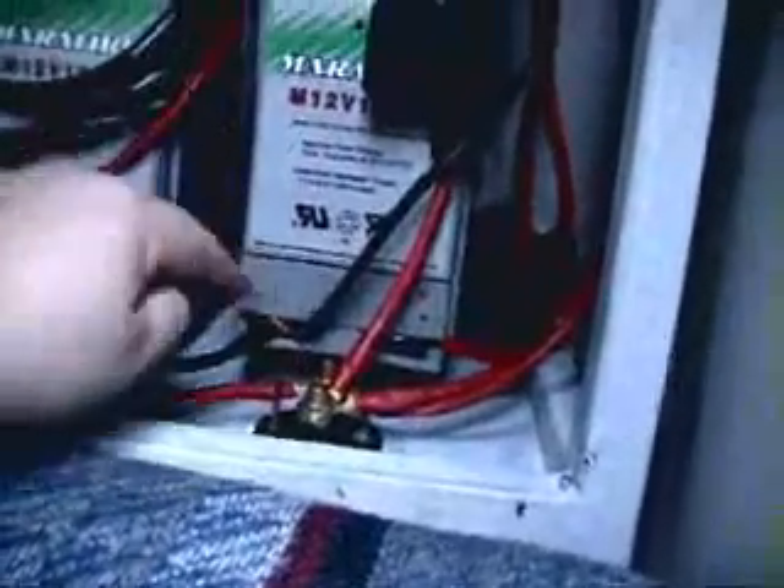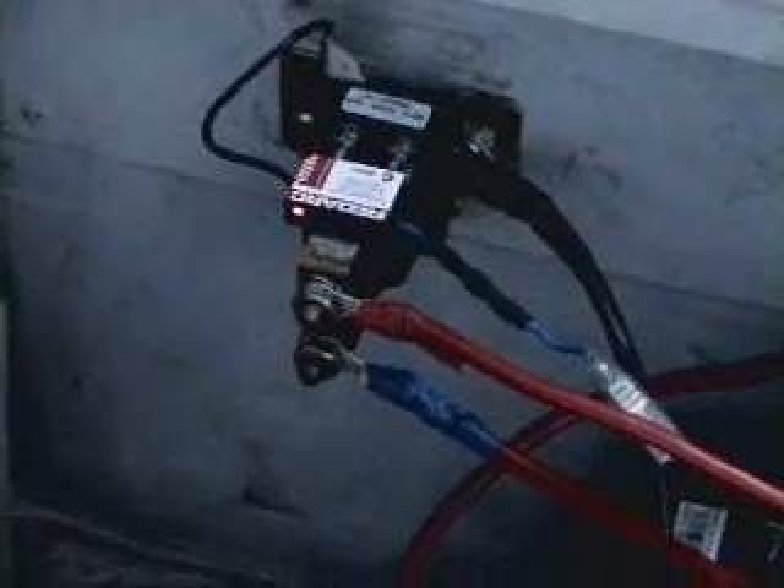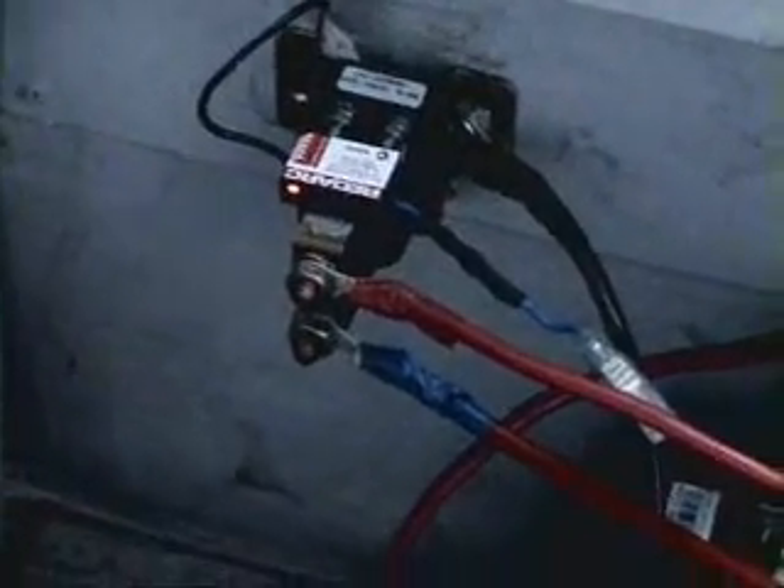It all looks very complicated, but we also have some wires which go down to the main batteries. The main batteries are located under the bed here. The wires come out here, go through this fuse, into this main switch, and then into the batteries. Now these particular wires are actually redundant — they don't go anywhere anymore. But in addition to the two batteries here, I have this little device which is a Redarc battery isolator. Basically once my batteries get over 13.3 volts, this switches in and there's a lead which goes back through this second fuse, underneath the vehicle, and to the main battery at the front of the vehicle.